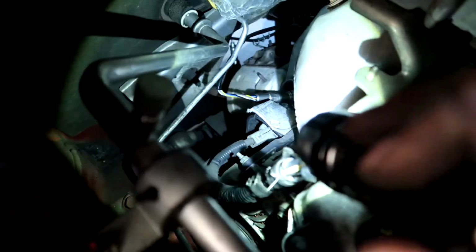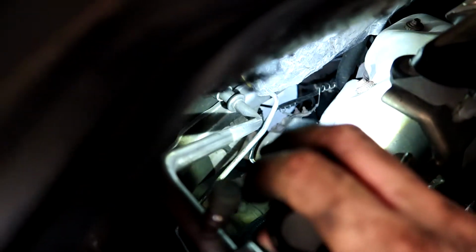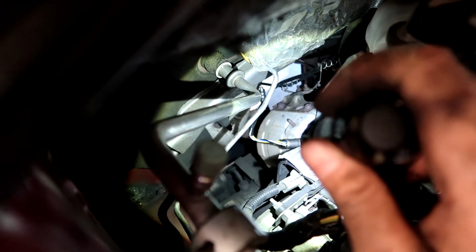And I am done. So both of them are in, both of them are looped through those weird springs. All three connectors are connected. Yes, this one, the primary oxygen sensor, it has two connections. The secondary one has one, a total of three. Everything has been tightened down. And honestly, everything looks good.